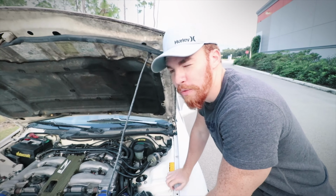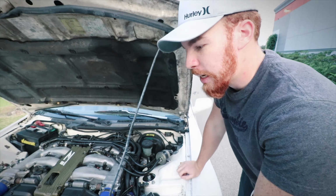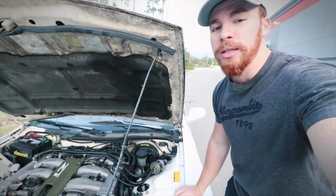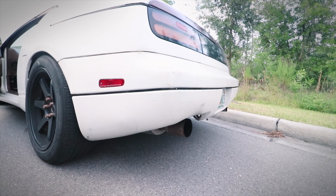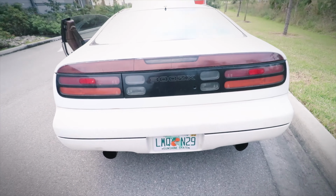Also, a pretty important thing, you want to check for vacuum leaks. You want to do a vacuum leak test. If you drive a twin turbo model, when you accelerate it should be hitting 7 to 9 pounds of boost. If it's hitting any less than that, it might be boost leaks, which are very common, but it might also mean that the turbo seals are going bad. The easiest way to check is if there's smoke coming out when you accelerate or do any pulls, the turbo seals are probably bad. So that's basically everything engine-wise for the 300.